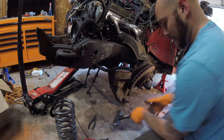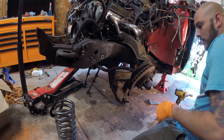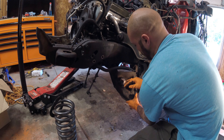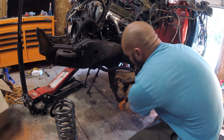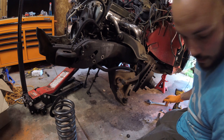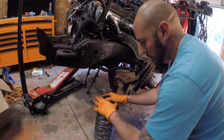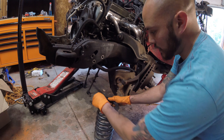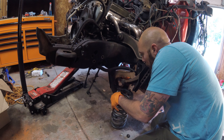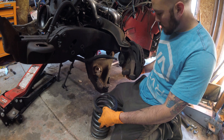I did not have to take the brake caliper off. So what you want to get ready for is you're going to want this lower ball joint to get right here in this hole. As soon as I get it to come in, I want to put the nut — so I want to have the nut ready, which is right here. I'm going to set it right to the side. Move my other pieces out of the way because I need the jack over here. And then people tape this — I don't have tape on me — they just tape it here so it stays put. You can see the indention in here — this is the lowest part, so that's where I'm going to put this piece.